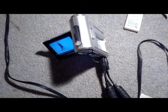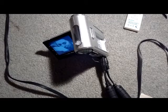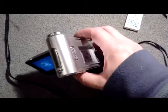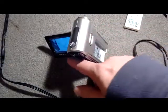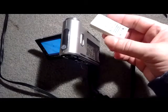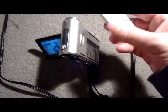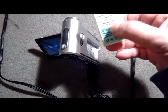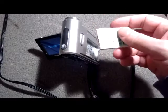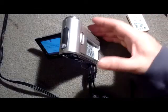This works with video from a cable box, DVD player, and many other sources. A lot of people who bought these years ago didn't know it had DVR capability where you could plug it into your TV and record programs. Some people thought that since the battery wasn't the best they should just get rid of it — but that's wrong, because you can use the battery just to trigger the device, then plug in the power supply and remove the battery to keep recording.